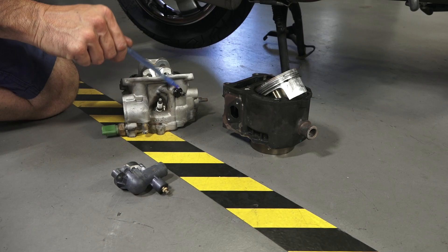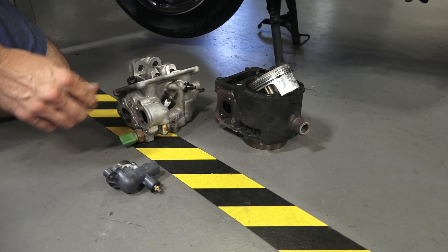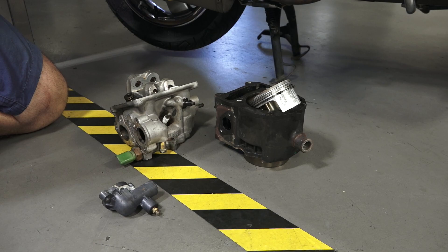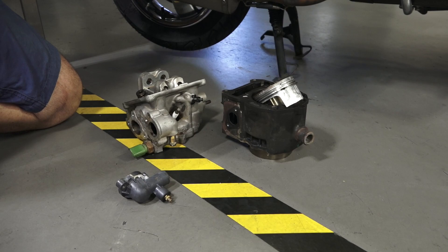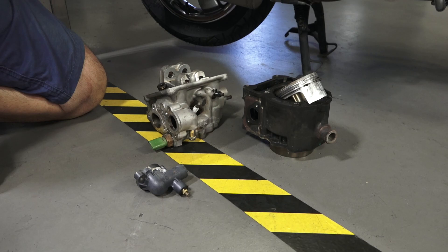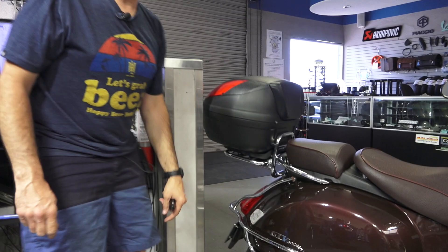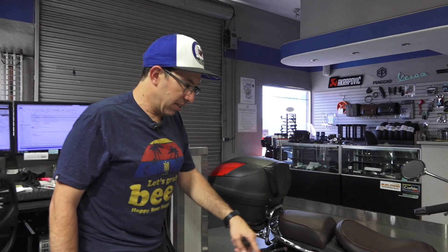I also point out it melted the plastic clip that holds the spark plug boot and case in place. I did a pressure check — filled each of the valve pockets, intake and exhaust, with water, and water leaks right through the head. It is possible to salvage this head: you could send it off to get machined and replaned, all the valve seats would need to be cut, and I'd suggest new valves. But I don't want to take any chances. I've had engines with internal cracks in the head before, and with a small head like this it's hard to determine. Sometimes it's not worth salvaging, especially since I know this engine was severely overheated.